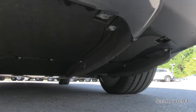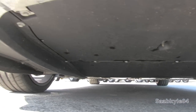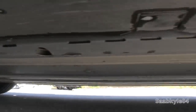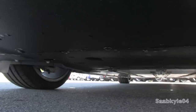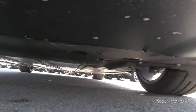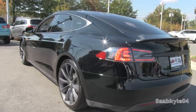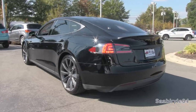The strength and durability of the Model S has been extensively tested to exceed federal crash tests and side impacts. The rigid chassis benefits from double octagonal alloy rails that run lengthwise down the car, while high-strength, lightweight steel is placed at key areas for further bracing. It also features a monotube shock absorber at each wheel, surrounded by the vehicle's active air suspension, which can be adjusted for variable heights or lowered automatically on the highway to decrease wind resistance to an astonishingly low coefficient of drag of 0.24.